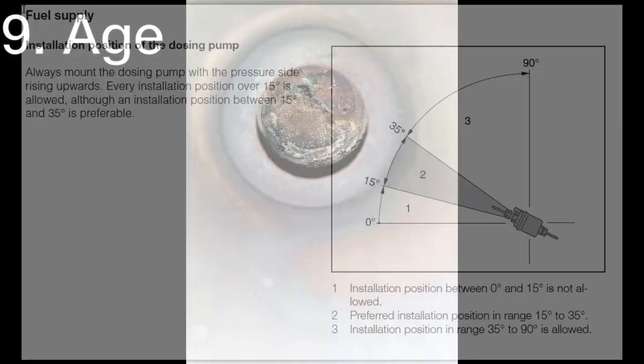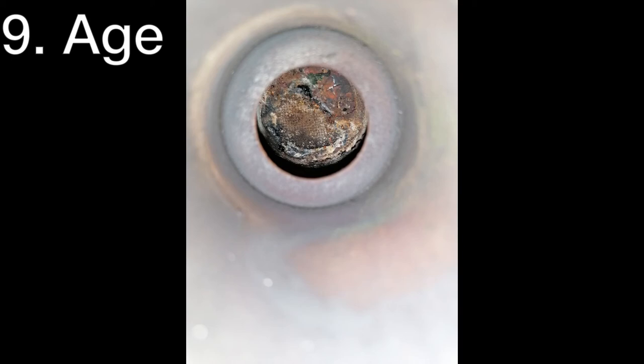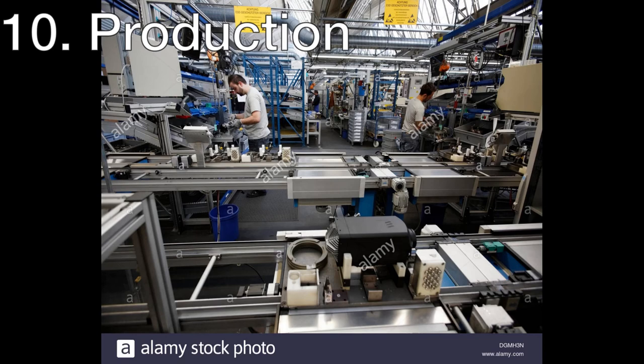The last reason is simply the age of the burner — the mesh inside is gone or so heavily contaminated with debris that the unit will not start anymore. The burner shown is from a hydronic heater but you get the idea, and of course this means buying a new burner. The thing that almost never happens are manufacturing faults or defects. In 99% of cases the problems come from outside the heater and not from the production process.